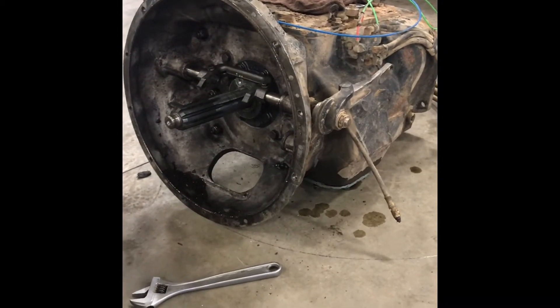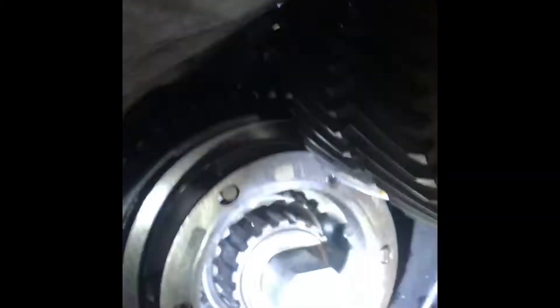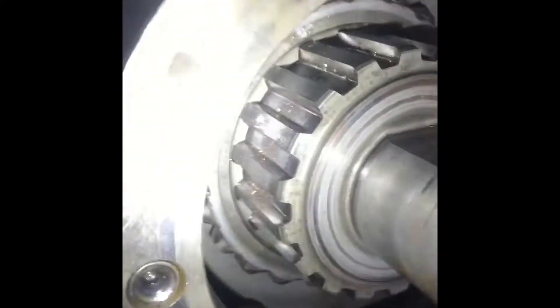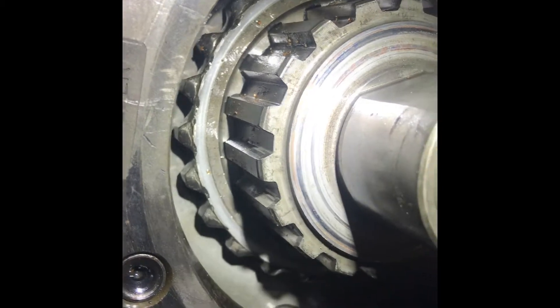So I took the auxiliary out back of this one and checked it. What I found was that his synchronizer has a rubber coating on the inside - kind of a rubbery material that helps you shift - and as you can see it's worn down. His synchro gears also have some wear on them as you can see there.